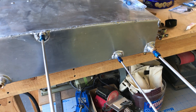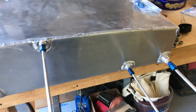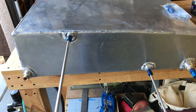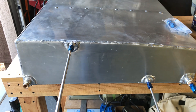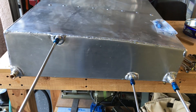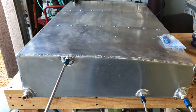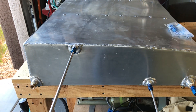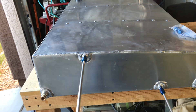These lines will get bent at a 90, kind of pointing down towards each other, and in between the two there'll be a clear piece of plastic tubing that will mirror the fuel level in the tank. With a glance I can just look at it. I opted not to go with fuel level float sensors in the tank — I didn't want to pierce the tank, it's another place for it to leak. I want to keep this stuff as simple as I can, and there's nothing easier than looking at a sight glass to see your fuel level.